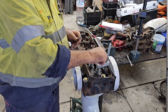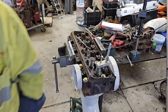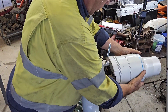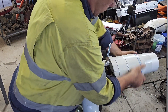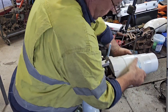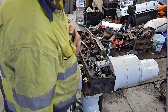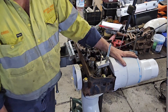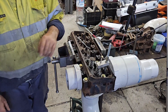So that now gives me my valve opener on the intake here. Before you actually make your adapters, work out where straight up is going to be and mark it — mark it 'up'. Now we have an intake adapter. This one here is my exhaust adapter, and this will make sense in a minute.